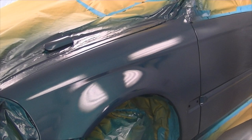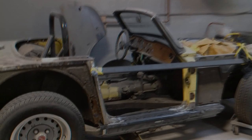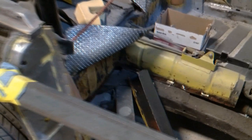We're slowly chipping away at the TR6. December tends to either boom if we get hit with a lot of snow or it can be a slow month, so we might get a bit more accomplished. We've got the floor cut out with a new one ready to weld in — restoration in a collision shop tends to take quite a bit longer.